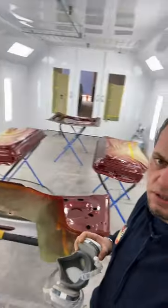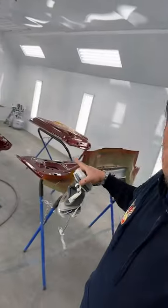So here we are. We are getting ready to shoot the second coat of clear coat. We don't mess around with the clear coat here, guys. We use enough of it, okay? Materials are no option for us because if you're paying top dollar to have that custom car done to your preference, there is no Mickey Mousing the materials. We use it all. So this car is probably going to have about 3 to 4 coats of clear coat. A lot of people will say that's excessive. I say it's not. And the reason for that is when this car gets detailed and polished throughout the years, I want to have enough clear coat for that owner to enjoy for many, many years to come. For those of you who know, if you skimp on clear coat, you're going to get pretty bad results within 5 years. Pretty bad. I mean, the sun could damage it. Next thing you know, you're flaking and cracking. So we don't do that here at Classic Steel Auto.